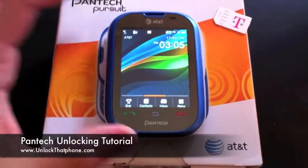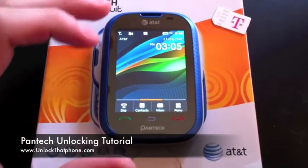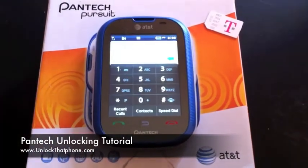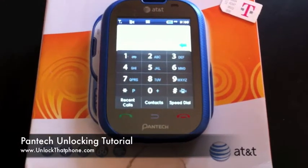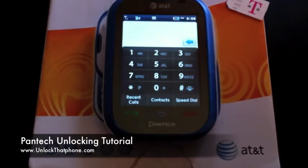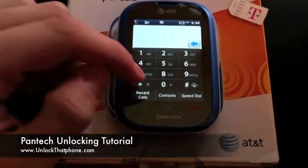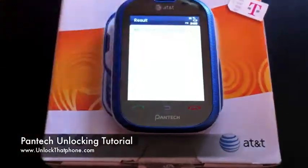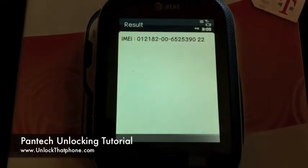So let's go ahead and get started with the unlocking process — it's very simple. The first thing we're going to do is get the IMEI of the phone. In order to get this screen to boot up you're actually going to need a SIM card that belongs to the carrier your phone is from, otherwise it will require SOS 911 calls only. So I do have an AT&T SIM in there. All you do is open up the dialer and dial star pound 06 pound, and when you do that you're going to get a screen with your IMEI — a 15-digit number unique to every single phone.